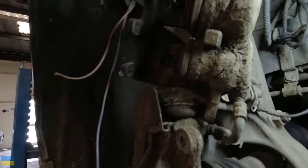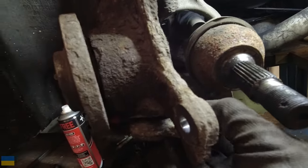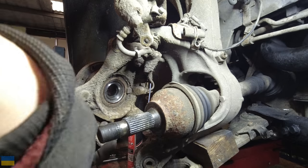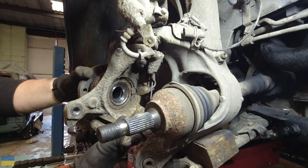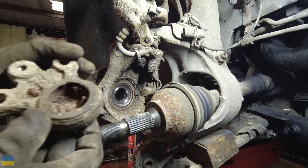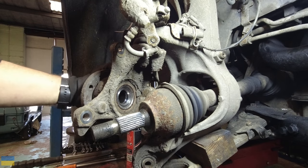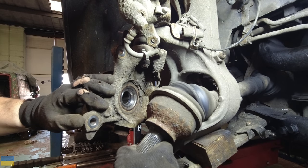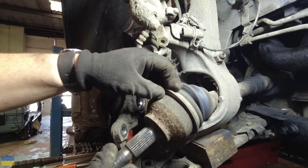I'm just looking at that and seeing Citroën C5 vibes all over again. So I've got the three bolts out for this ball joint and there's quite a bit of play in it. Oh yeah — the bearings are hanging out. I've never done one of these before, just watching people on YouTube do it — a fella in France, couldn't understand what he was saying but I got the gist. I think those bearings have seen better days. Also, what's also seen better days — it's got to be my noise source — is floppy as anything as well. It has had previous MOT failures and advisories for split gaiters, so straight away you think: how much grease did it lose? So I'm just going to do the whole shaft.